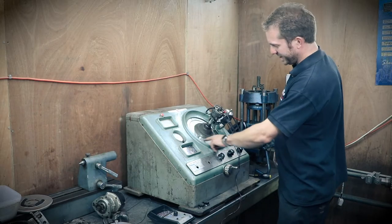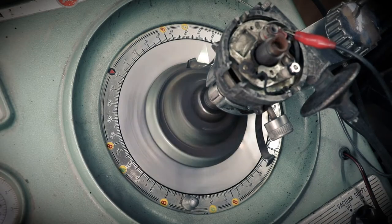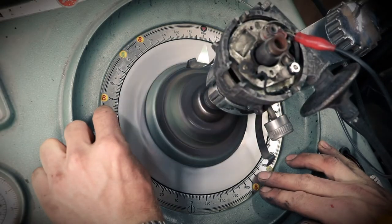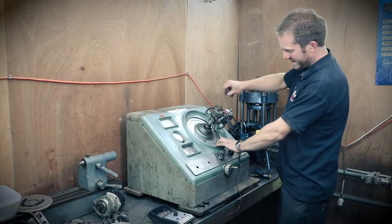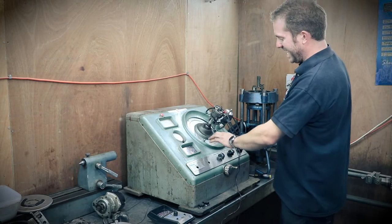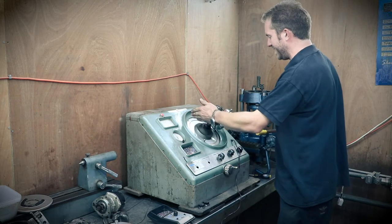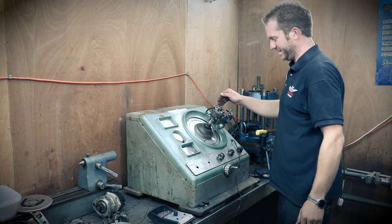You can see it's flashing regularly at four intervals. You line up this ruler with zero, and that now shows us that it's firing equally — firing at zero degrees, 90 degrees, 180 degrees, and 270 degrees.